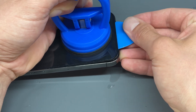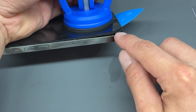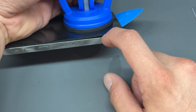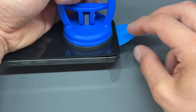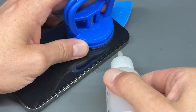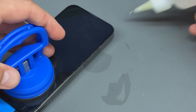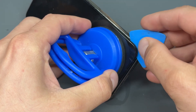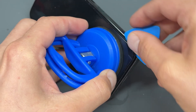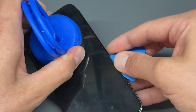The reason I don't warm them up anymore is because I found that the risk of the screen frame separating from the OLED and the glass is much higher when it's warmed up. So I just use no heat, a little bit of alcohol, and it works perfectly. Now I'm going to run a bead of alcohol all the way down that edge and the opposite edge, and I'm just going to run this plastic pick — inserted a couple of millimeters — and you can see how easy this is peeling away.